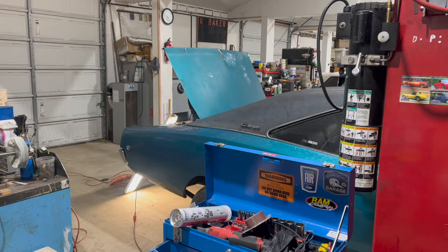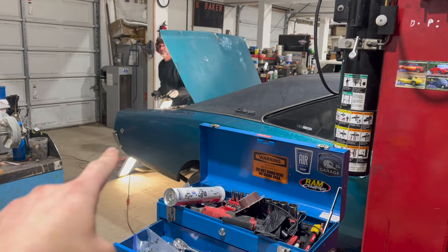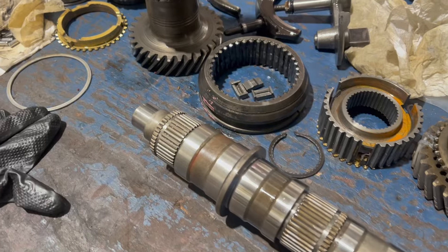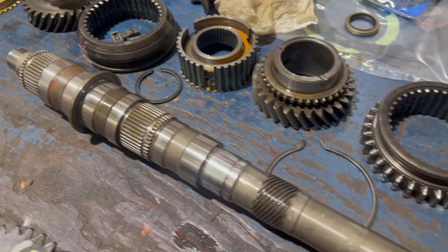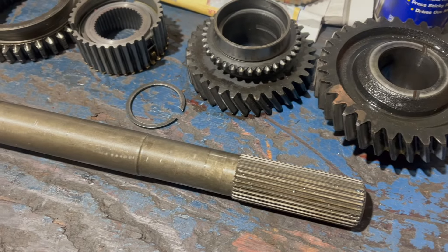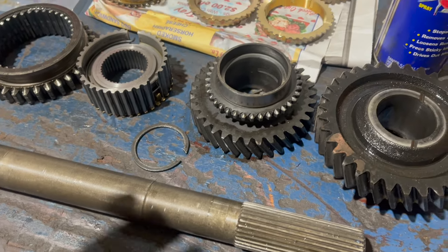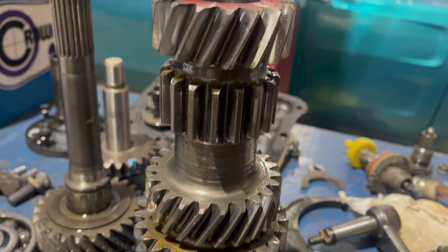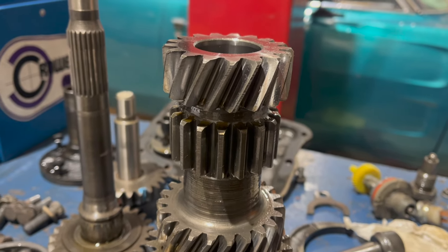Time to eat a sandwich. While Trev beats Tom's Charger mercilessly with a hammer, I'm going to clean four-speed components. As I'm cleaning, I will be looking over all of these components and making sure there's nothing else to worry about - no horrible dings on bearing surfaces. I'll also be looking over all the gear teeth, and they look pretty good. Most stuff in this transmission does.